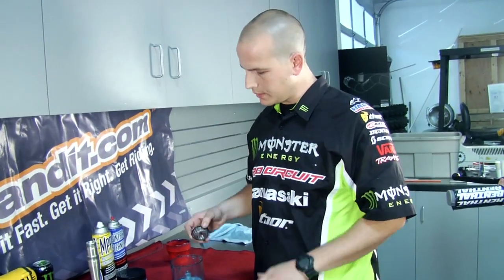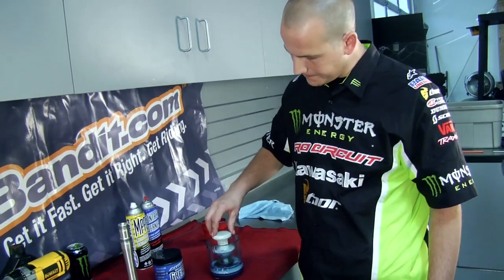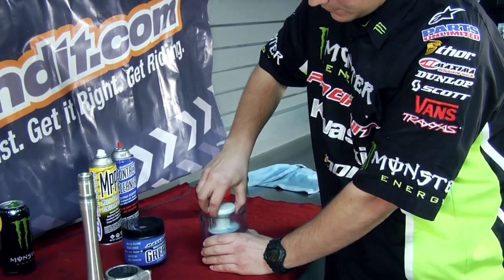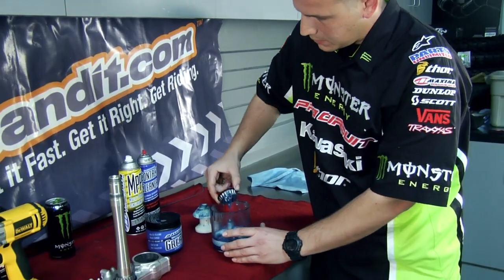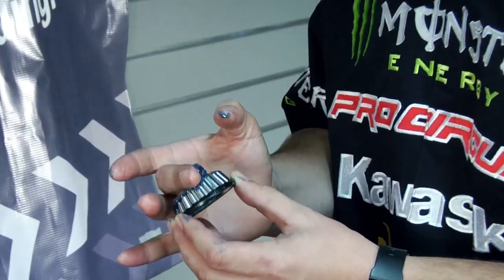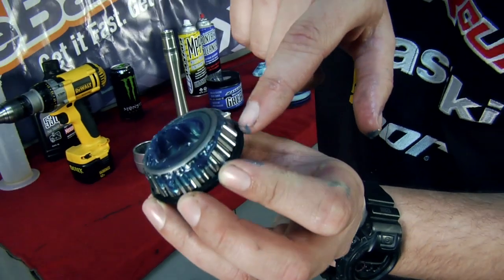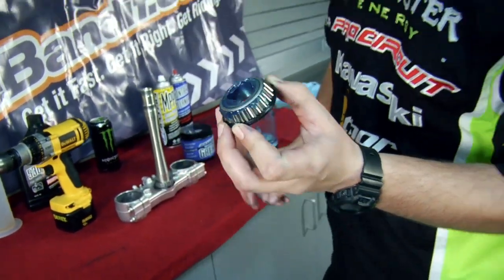Just make sure the bearing is face down inside the packer, slide the little plunger over it, and kind of work it back and forth or in a circular motion. Pull your plunger back out and look over your bearing. Right now it just looks like there's a bunch of grease on it, but it actually needs to go quite a bit further — you can see how nothing's really coming out of the bottom yet, which means the bearing isn't full of grease.